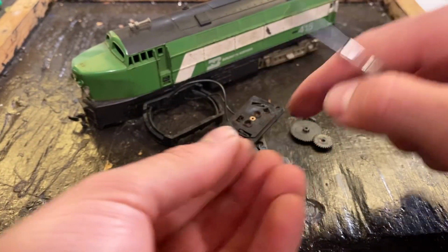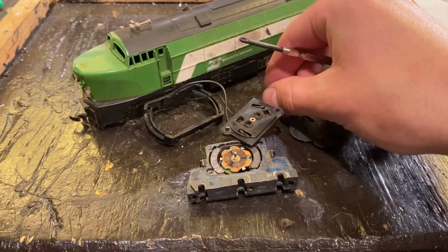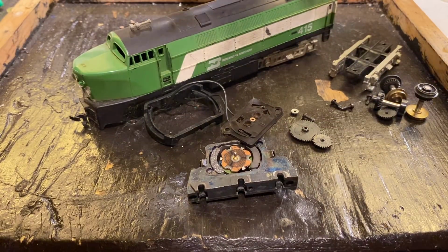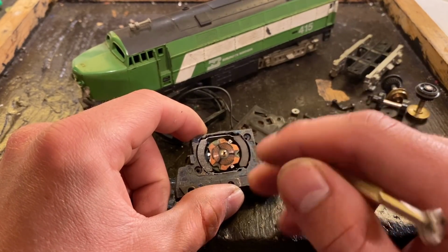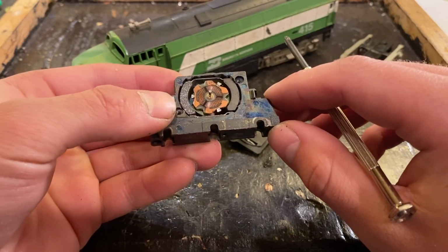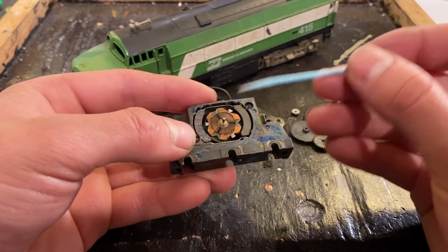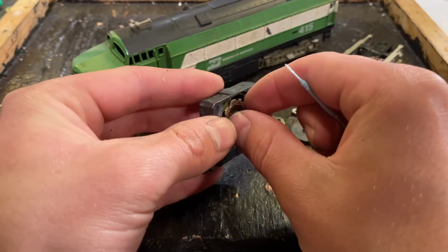I mean, you need adequate pressure, obviously, to push the brushes into the commutator. So yeah, if these are compressed, either try to stretch them back out, which is kind of the red-green way of going about things, or if you want to be really professional, you could try to buy new springs or salvage them off something else, but I personally find that a little bit tricky to do sometimes. Yeah, overall this is not bad.